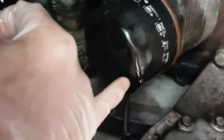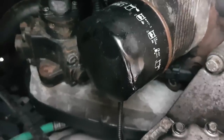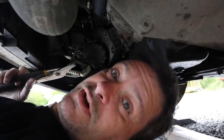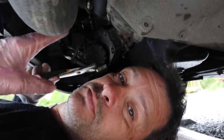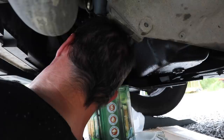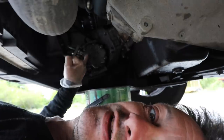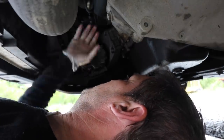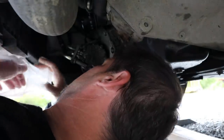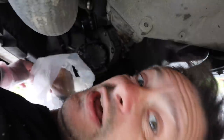Just to remind everyone what the problem is — dripping here, there's a tiny little hole in the end of the filter, and it's just been dripping out very slowly over many many months. I was trying to get you an angle so you could watch what I'm doing but I need both hands free. I've noticed one problem straight away — the oil filter is directly above something else, so when I take that off, all the oil is going to drip all over that engine part, so I need to get a plastic bag around it.